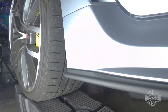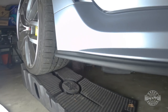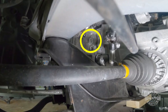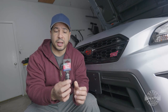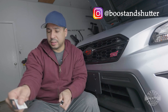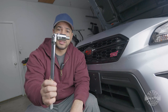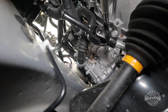Now for the fun stuff. For reference: this is the driver's side front tire, and if you go under the car just in front of the axle, you can see the bolt on the head that we're going to remove to get that plug out of the engine block. You're going to need one of these 12 millimeter hex bit sockets — I had to go to the auto parts store to get one. It has a half-inch drive, which lets me put a breaker bar on it to crank that plug out. You'll also need some extensions.